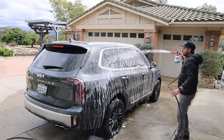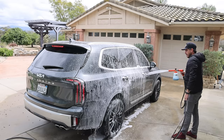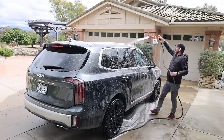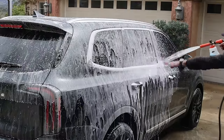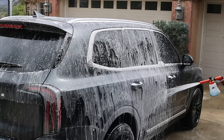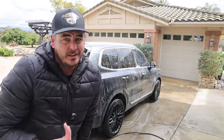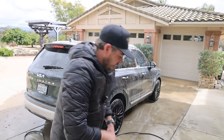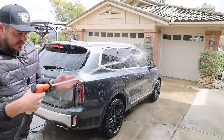As you can see, as a foam blaster hooked up to a garden hose it's going to do the job — it'll apply it in a nice even pattern, it's just not thick foam. It is applying the product and that's what we want. I like to go from top to bottom so the material drips down and we get nice even distribution. That's it — we've applied it. Now all we have to do is let it dwell for 60 seconds, then rinse it off. You can let it dwell a little longer if there's no direct sun and the panel is cool, but don't let it dry on the surface.